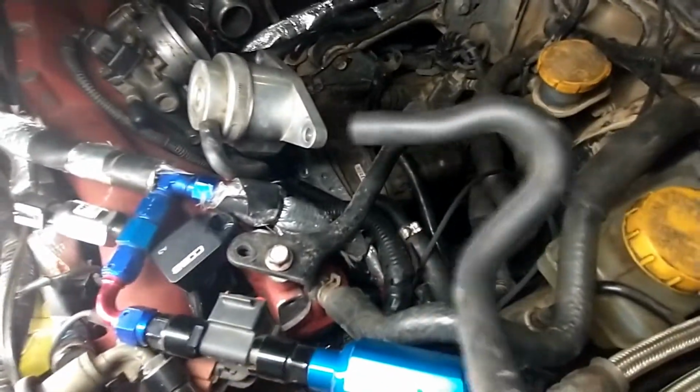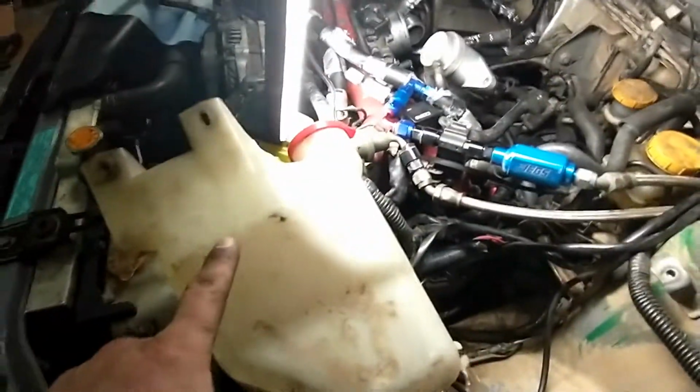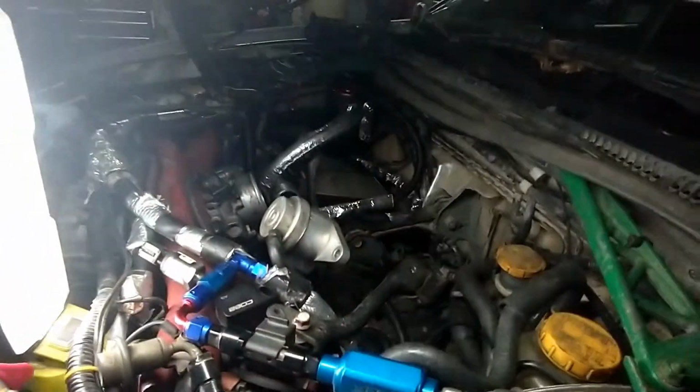In the meantime, I'm starting to put the next hose, which is the PCV hose on the driver side. So here that's the hose that originally went to the intercooler here, and it is the first one of those two hoses here on the block. I recommend to pop the 10mm to remove your windshield washer bottle so that you can get easy access here. And we're gonna connect this to the next spot on the bottle in the middle.